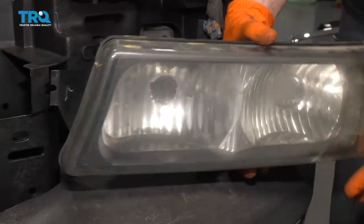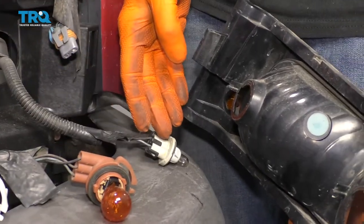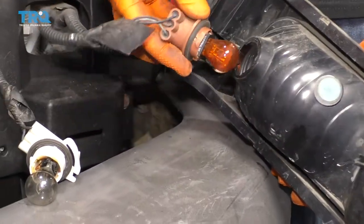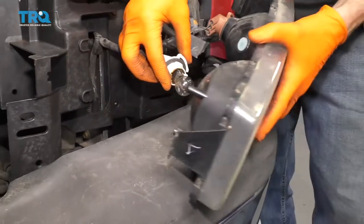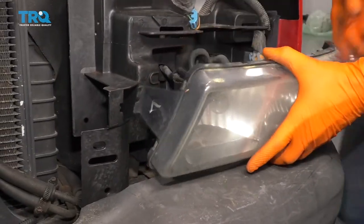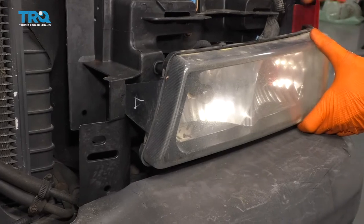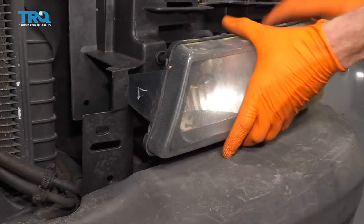So now it's going to be time to get this installed. Go ahead and turn it backwards. Make sure you grab your three wiring harnesses here. You have your little one for the marker. You have this one right here — it's going to go in the center for the directional, and this one right here is a little running light. Click it in. Put your little tab down and behind there, and then go ahead and press this in. Just make sure that you don't have any wiring harnesses behind there. Latches in — give it a nice tug.